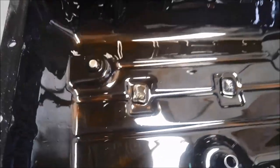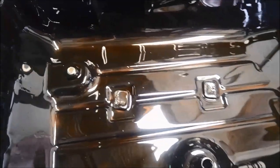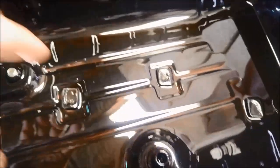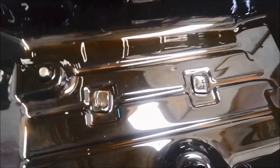So it's important to actually remove the pan, not just to drain the oil and change it. It's important to clean those magnets, otherwise that fine metal will become attracted to the solenoids.